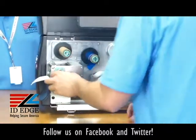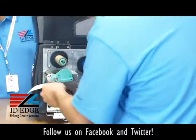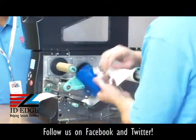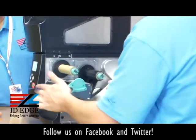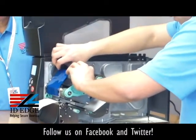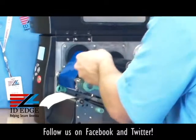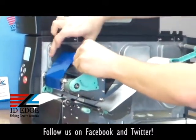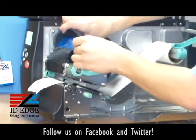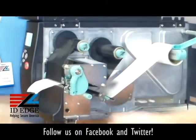Make sure it clicks in there. Next, open the print head, then slide the ribbon under it. The ribbon already comes with an adhesive tape that will stick to the take-up. Go ahead and spin the take-up just a little bit until the black appears — the blue comes on first, which is just leader so you don't waste any ribbon. Then drop the print head.